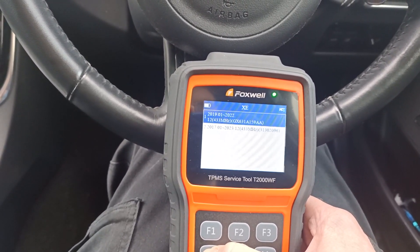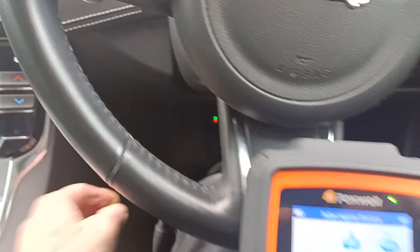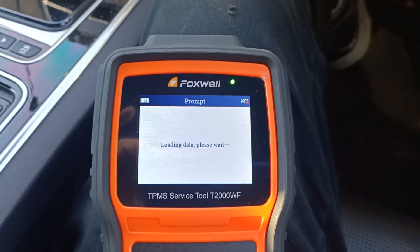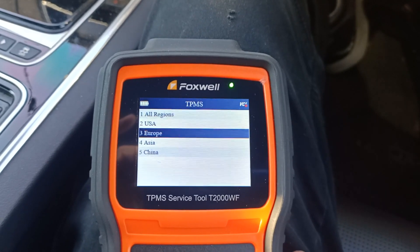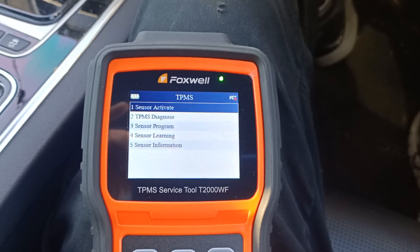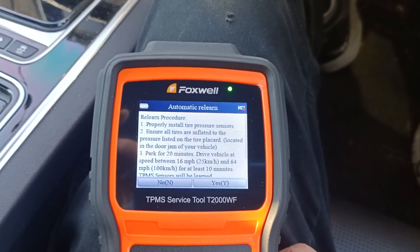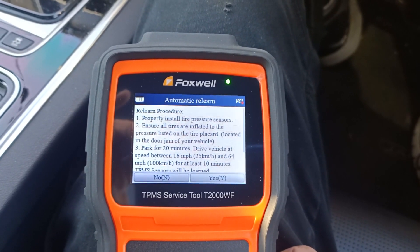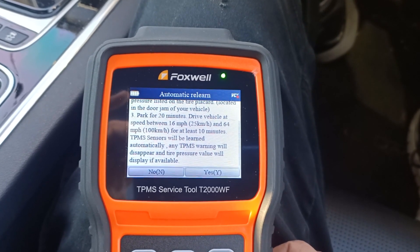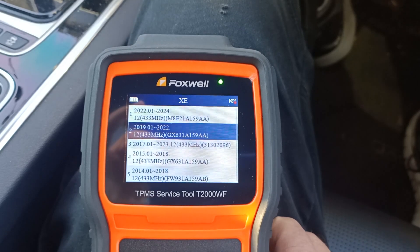We'll drop back out of here and remove the VCI. There's also on here a procedure — if we go into the software again for the Jaguar, it tells us how to actually get the car to accept the new sensor ID. Because the new sensor we've put in replaced a dead original, we didn't have the ID. But if we go into sensor learning, there's an automatic relearn procedure that gives us details on how to get the car to recognize the new sensor. In this case it's fairly straightforward — just driving the car for about 20 minutes and it'll pick it up. But some cars require you to actually program an ID number in using the VCI; the tool will tell you what you need to do.